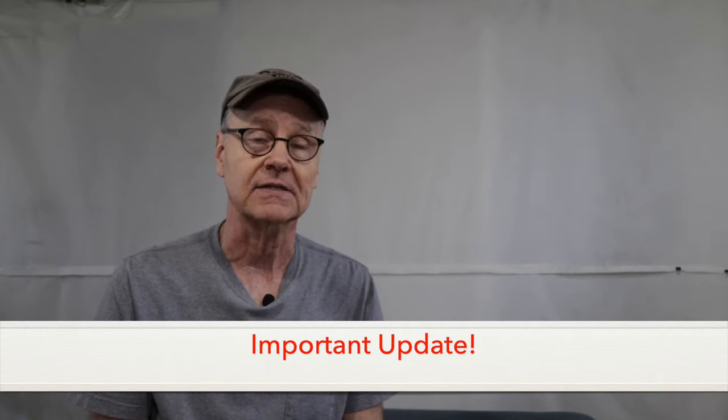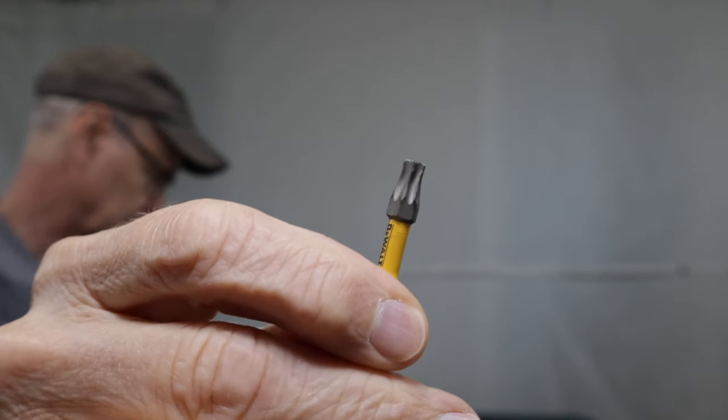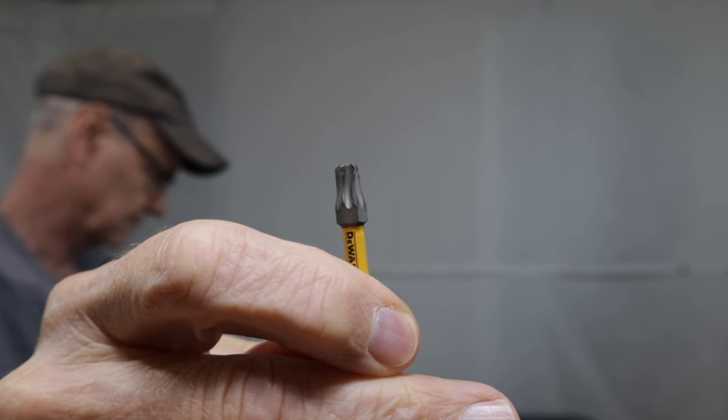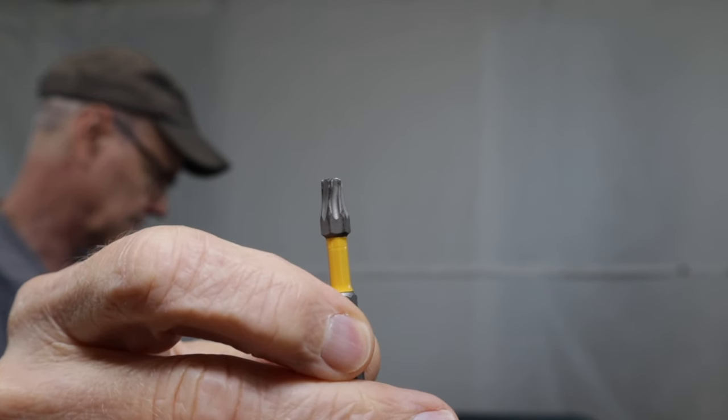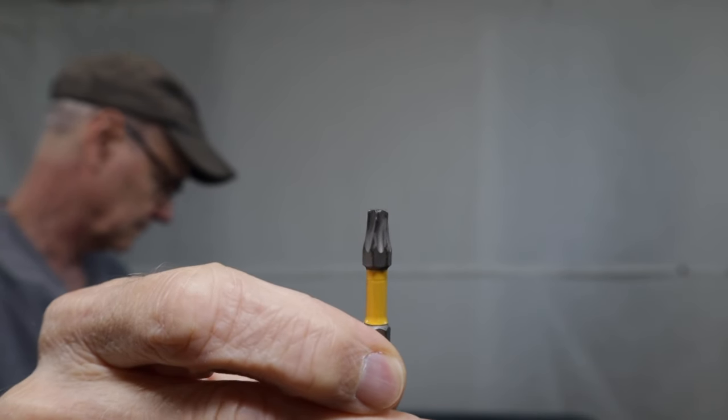Not long after I finished this video, I had to do two of these repairs. And in each case, one of the bolts would not come off. In fact, I ruined two T30 Torx bits trying to remove them. When these bits fail, the little spines towards the tip will begin to bend or twist right before the bit fails. On that first repair, I wasn't able to get the bolt out, so I ended up drilling it out. On that second repair, I think I found a better way to break the bolts loose, so I'm going to do a close-up here to show you what I found.